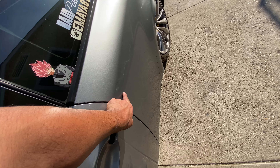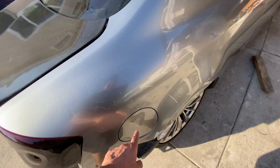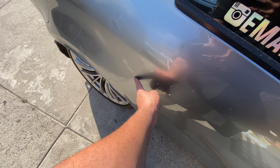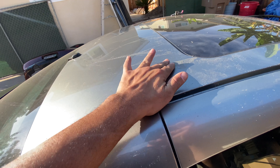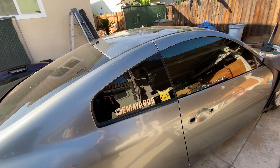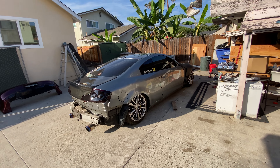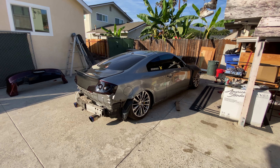There are spots like right here and right here, and some spots on this side as well. We've got a little bit of glue stuck that we're going to have to take off — that's nothing too bad, we should be able to get that cleaned up. Then we are going to re-sand down the whole car with probably 2,000 grit to smooth out all the paint from any parts that might stick out when you put the wrap down.